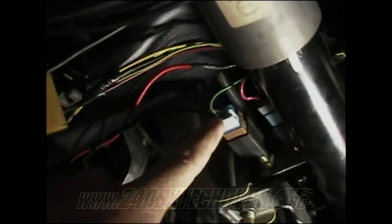And then also over on the clutch connector, you have the green and black wire running off that. I have a red wire running off of it, and it goes up to and connects to the harness where the brake connector is, that's where you split it. So basically all it does is it loops this connector in line with that. From where you cut the wire off the brake connector and the harness, it just basically loops that connector through. So that's how that works.